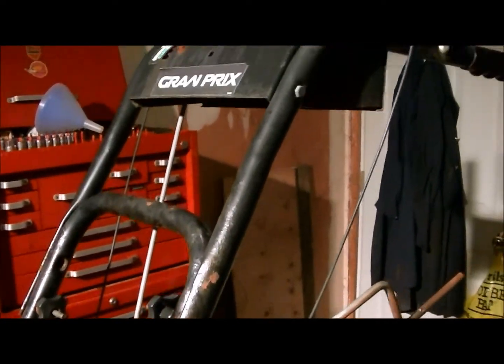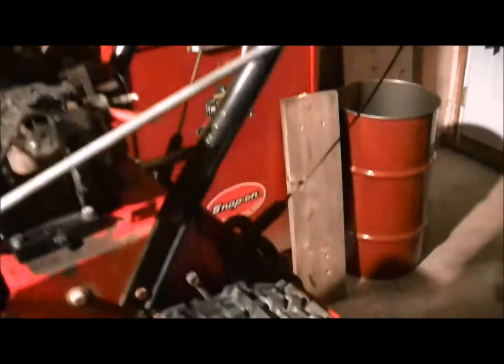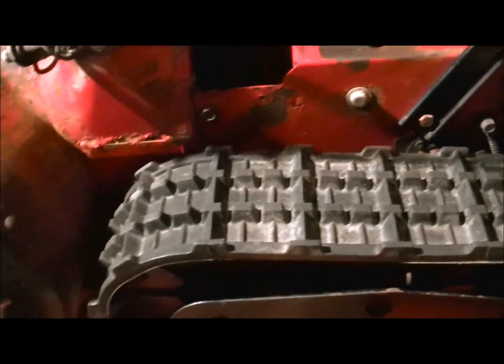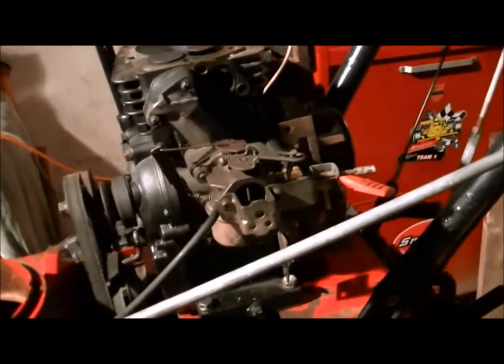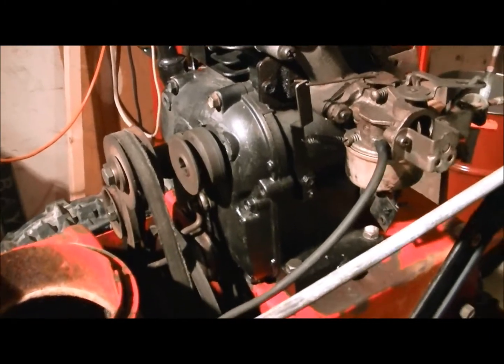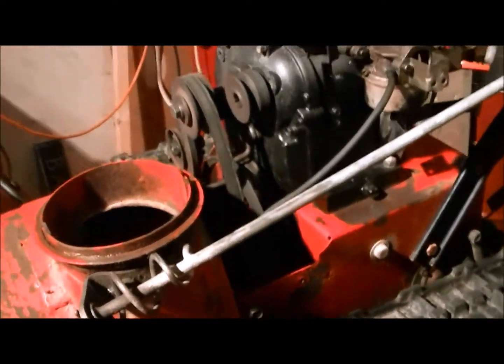This blower isn't gonna fetch any real money - it's all rusted out - but there's lots of parts off it. I think I'm gonna strip it of what I need and save some of it. These track drives are pretty interesting. All the linkage was seized underneath so I got it freed up, but it's just been sitting outside for a few years. I have a little motor over there that I can use this carb for - it'd be a good donor motor, or maybe I'll just put another end casing on there. I think it's destroyed the area where the seal goes.